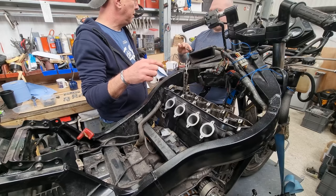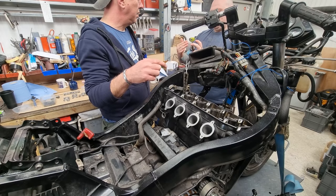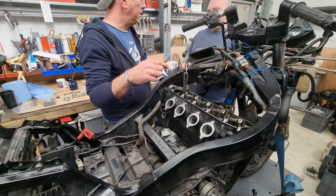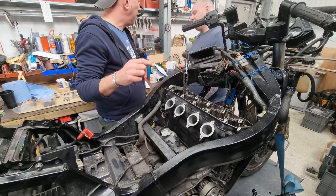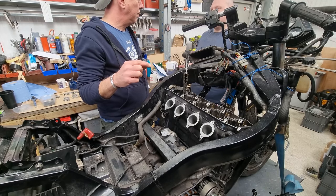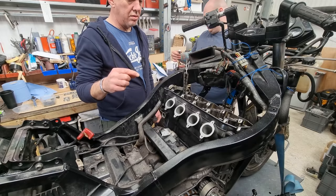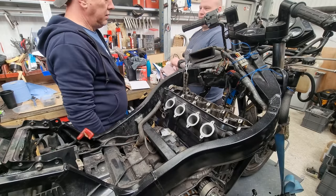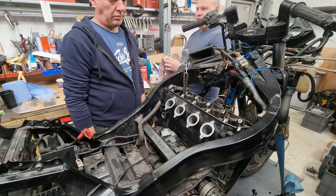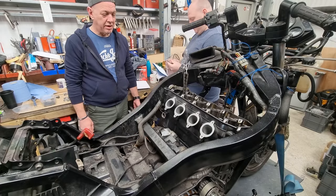The first time the tensioner touches the chain it won't be as extended as it's going to be. So you rotate it to get all the slack at the back and then the tensioner will pop out to where it wants to be. By rotating it three or four times and making sure that every time we get back to TDC on the compression stroke - sorry, the inlet stroke - everything is still where it should be, count all the chain pins again, just make sure it doesn't jump. That would also tell you if you had a stretched cam chain.